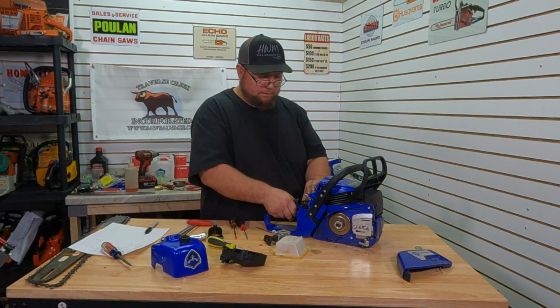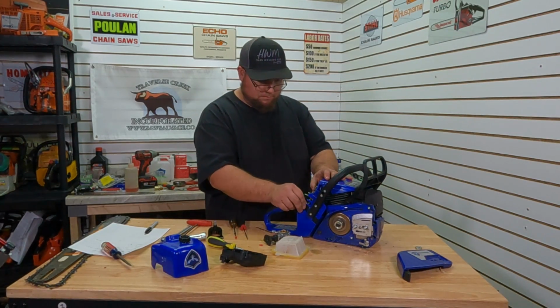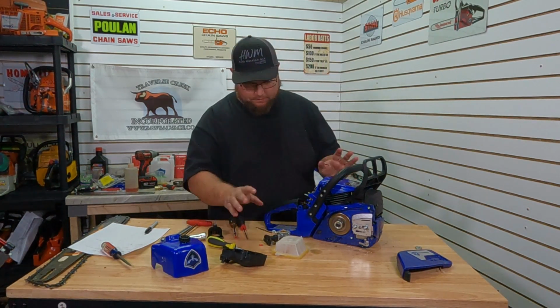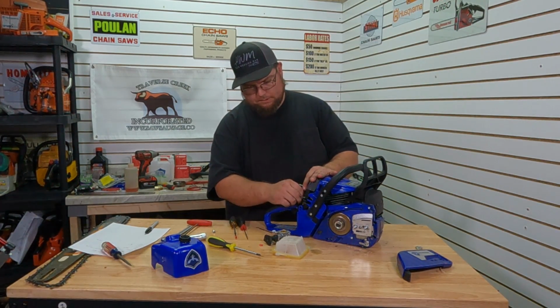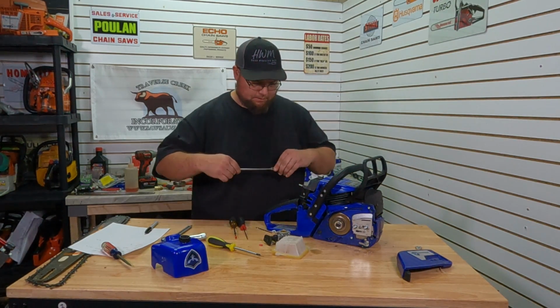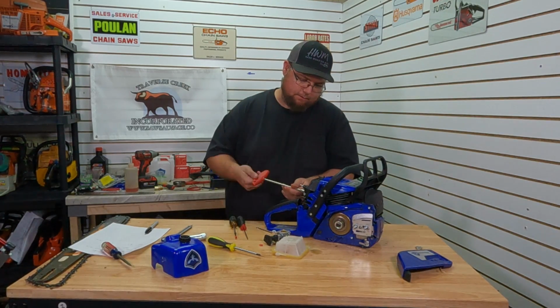Okay, so we are going to have to do some work on the choke, but we do have full throttle and we have our ignition switch. So that'll work for now. Let's put everything back on. We just won't be able to use choke with this setup, so we will have to swap the choke rods out. But this will show us what kind of gain just swapping to a larger carburetor gets.